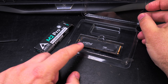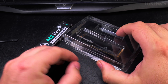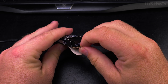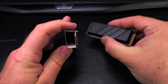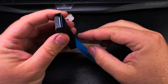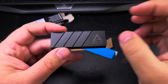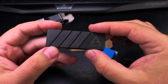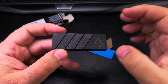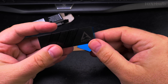I had the option for Kingston V3 and the Crucial P3 Pro but I preferred this one — it had better specifications. The cooler feels really solid, like a matchbox but very sturdy. With coolers for NVMe it's actually important to have thermal capacity, meaning the more material there is the better, because NVMe drives have bursts of really fast reads with heat generated quickly, and then they sit idle. There's the Arctic branding on it.